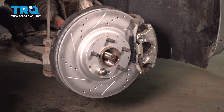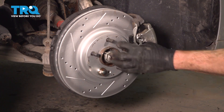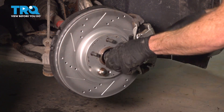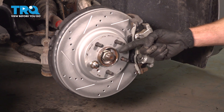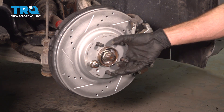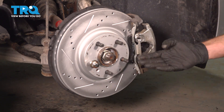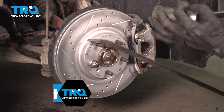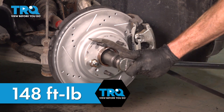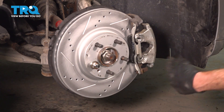It's time to install the axle nut. When you install this, you never want to use an impact tool — it can cause damage to your bearing. Snug that up. Now we're going to torque this to 148 foot-pounds. What you'll find is this will want to spin on you — we want to prevent that from happening by carefully using a pry bar diagonally down past the lug studs down to the ground. Let's remove the lug nut.